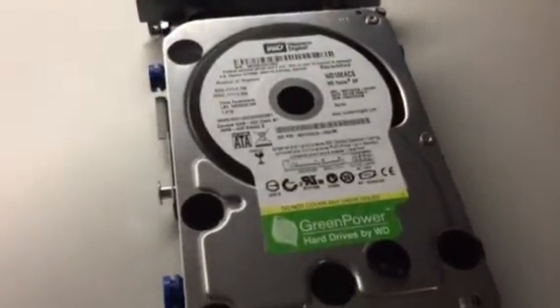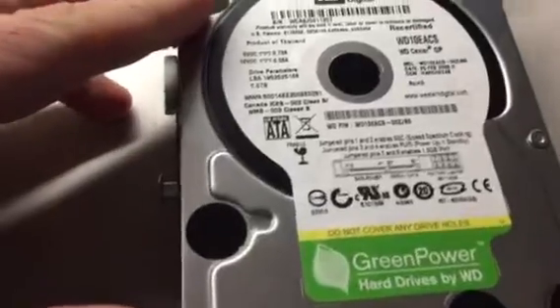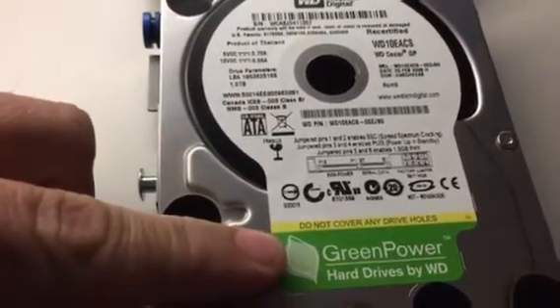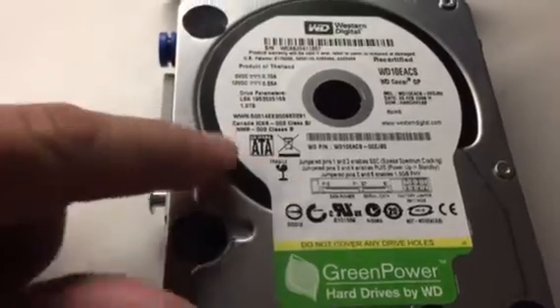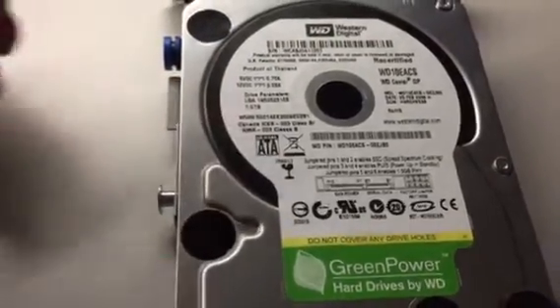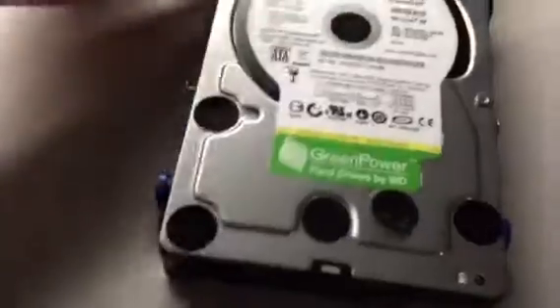When you do that, this metal plate on the back easily comes out like that. There's the inside. There's the drive. Now this is a replacement drive — this is a Western Digital. The green power drives are the ones typically used for DVRs because they are low noise and lower power consumption. This is a one terabyte drive. All I did was take the 500 gig out of this pretty standard case and put the one terabyte in, line it up so that it goes in like that. Boot it up and give it some time because it will go ahead and format the drive, and it was done and running. Everything was good.